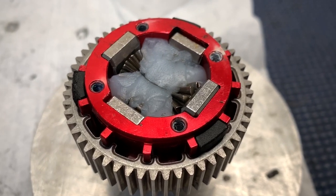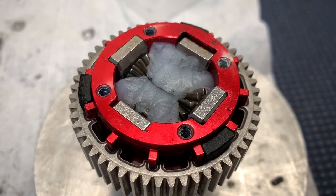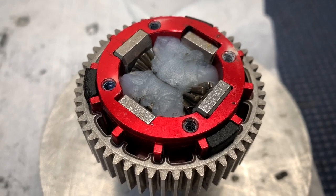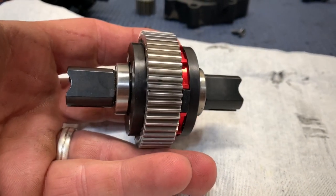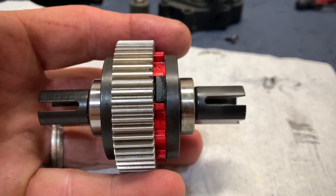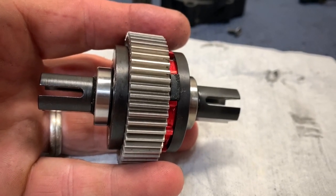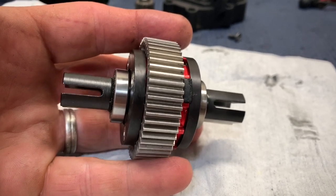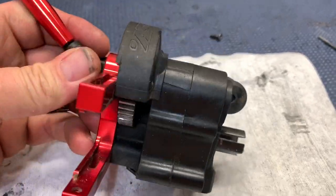The one concern is there's no real lubrication left in it, but if it doesn't actually turn inside then heat shouldn't be a problem. There it is, ready to go back in. I was actually able to turn it with a hex wrench in the slot, so there is still some differential action even with the plugs in there — but it's a whole lot tighter than it was. Now it's time to put this back into the chassis.